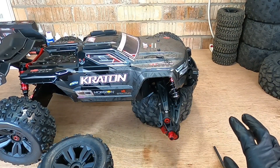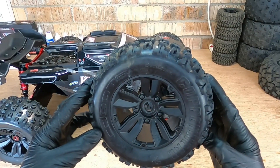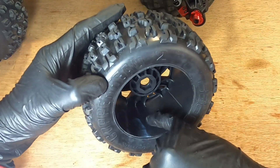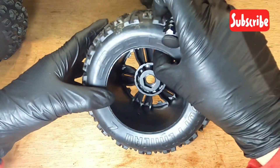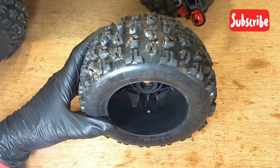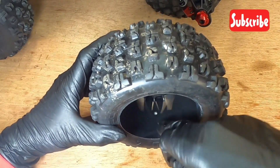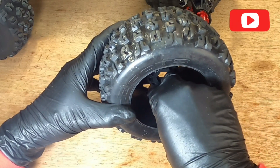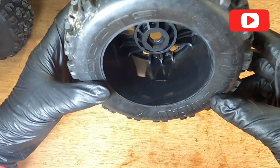That's something you should keep an eye on as well. Now let's vent the tire. First job once you remove the wheel is to seal the breathing holes inside the rim. You can see there's a hole there, and there tends to be a second hole on the opposite side as well. We need to seal these — the way I do it is with electrical tape. Make sure it's nice and clean, cut some squares, and make sure it's stuck down well. Do the other side too.